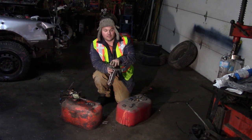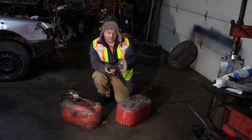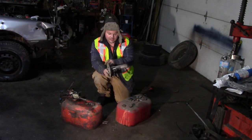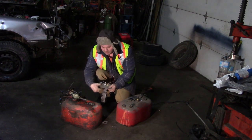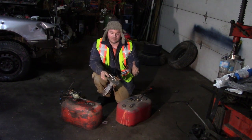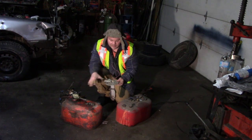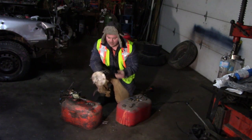As you can see, this Crown Vic pump has a return line. I've had to replace the pump on this once because the factory pump did die. But what I really like about these is you're able to basically just cut a hole, sink it in, put a whole bunch of Seal-All - a chemical that seals these in and is very fuel resistant - then put holes in all the factory bolts and add extra holes to make sure it's bolted down.